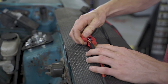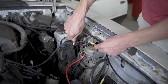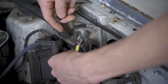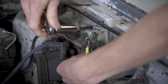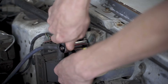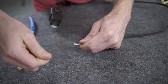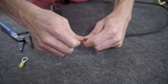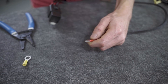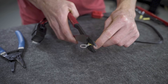They want the main power wire with the circuit breaker as close to the battery as possible for optimal circuit protection. Depending on your setup, this can connect to the battery itself, the battery side of the starter solenoid, the lug on the alternator, or if you have a coyote swap, this wire can connect to the main power lug in the fuse box. This wire can be cut to length if desired. If it is cut, make sure to wrap the end of the mesh loom with electrical tape or use your own heat shrink to prevent the end from fraying. Install the provided large ring terminal onto the red power wire.